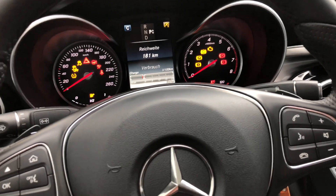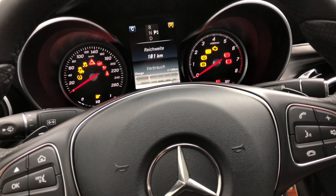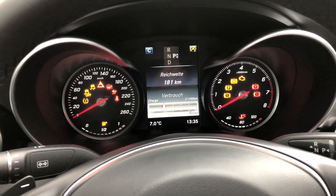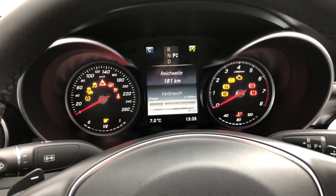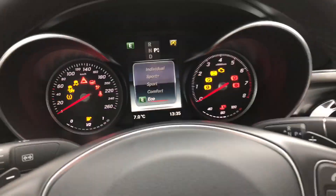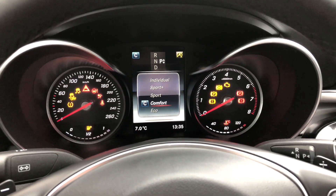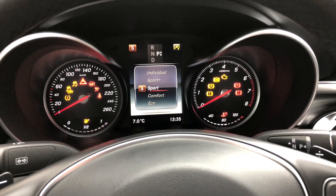If the indicator lens in the Eco Button is lit green, this is important: the outside temperature is within the range suitable for the system; the engine is at normal operating temperature; the set temperature for the vehicle interior has been reached; the battery is sufficiently charged; the system detects that the windscreen is not fogged up when the air conditioning system is switched on; the bonnet is closed; the driver's door is closed; and the driver's seat belt is fastened.